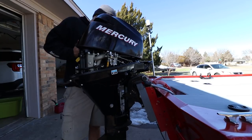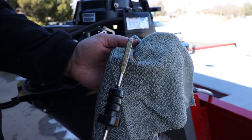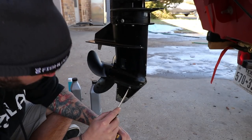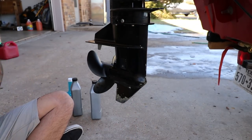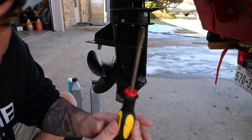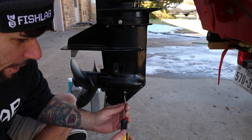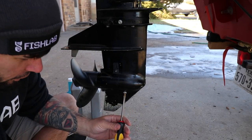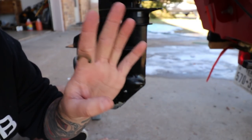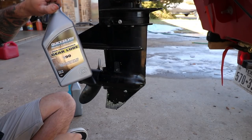I already took the top off, so let's go ahead and check a few things and then we will start her up. First off I want to check the oil — I'm pretty sure it's still fresh, still new. I went through all this stuff six or seven months ago. We're gonna check it and just make sure it's all good. I'm going to check the spark plugs next. Also want to open up the gear lube a little bit and just see how it looks — make sure it's still a nice blue color, make sure there's no water in there. She's a little dark but that still looks good, still has some blue in it, so I think we're good for a few more months.